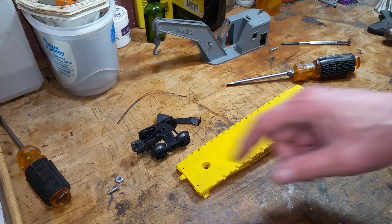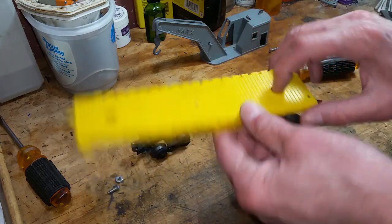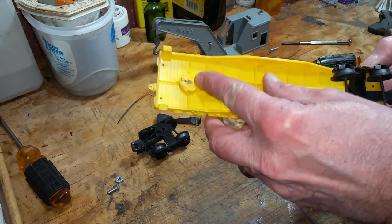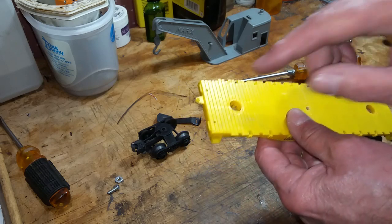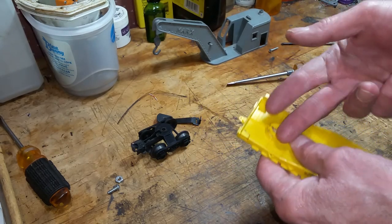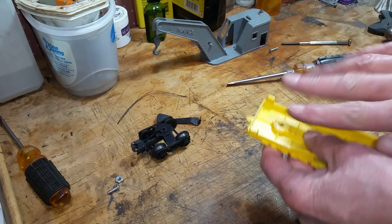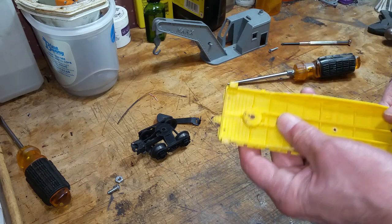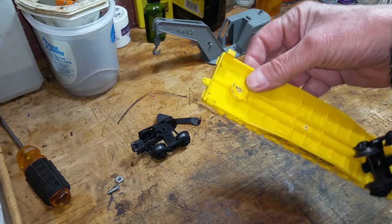So a really simple way to replace these trucks. They're held on with rivets, as you see. In this case, the entire thing broke right out and broke the truck. So if you have to actually remove the rivet, you can just use a pair of dikes or side cutters and snip it off. And it smashes it flat, so cut it once that way, poke it through the hole. You see, this one is cracked right there, but more than serviceable.